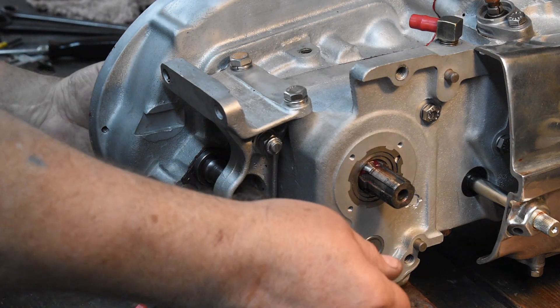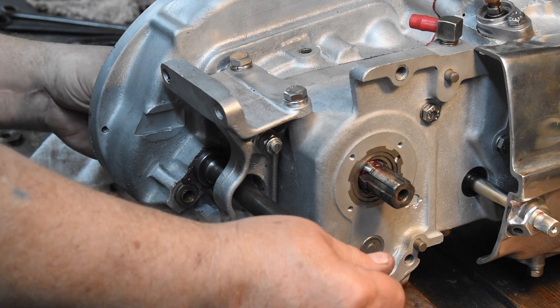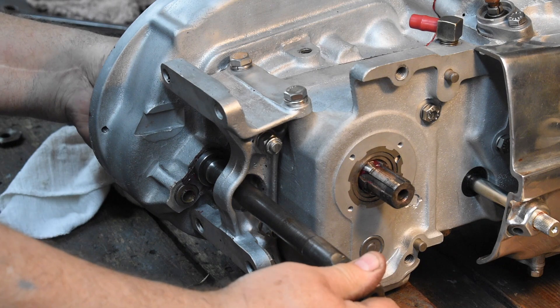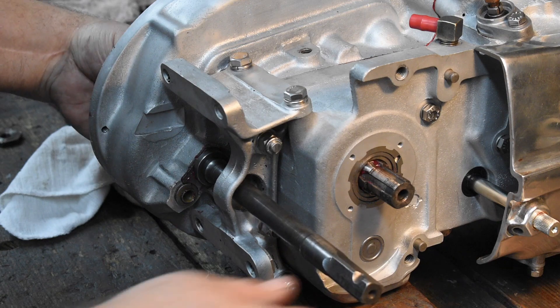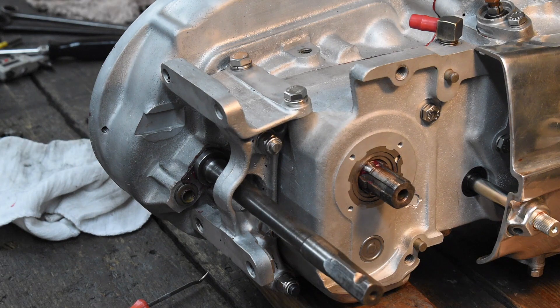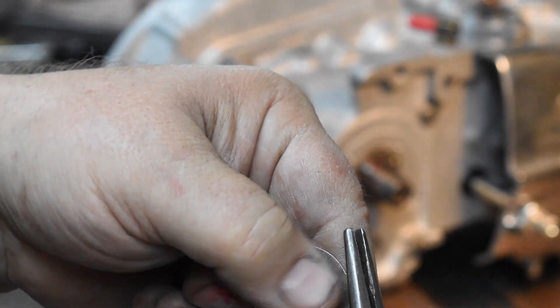You've all seen the bike where the guy puts this in wrong — he's got a hole all cobbled out sideways in there because he forgot to put it in the right spot, and then he had to grind the shaft to get it to fit. What a mess. Do it right the first time; it's easier. My gear is set to stop, the bolt's pointing up — that's the way it needs to go. Put a new lock washer. I like to bend the ears up a little bit to make it easier to get underneath when the nut is tight.